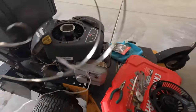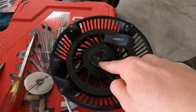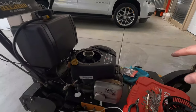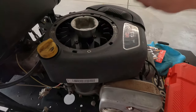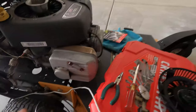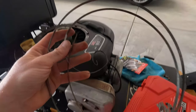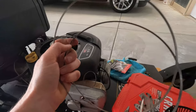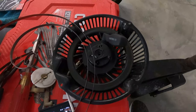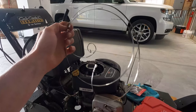Here's what I'm doing. This is a coil spring that goes inside here, and then this flips over and goes on the top of the mower — this is a 36-inch walk-behind mower. When you pull it, it starts the engine and then recoils back. The problem is I wasn't paying attention when I took this coil spring out, and this is what it did.